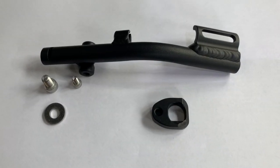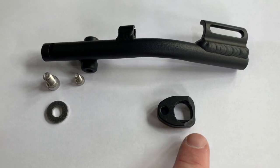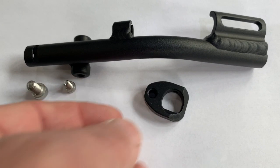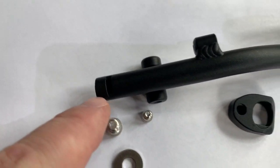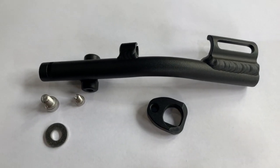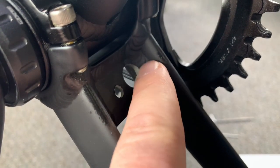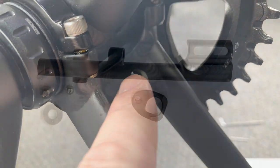Here we have all the parts for the derailleur stock. We have the lower bracket — notice it has a bevel on the end. The bevel is important as it clears the weld. It also has a notch on it that corresponds with the notch on the front of the stock. All of the parts assemble and only go one way. Note the weld here — that's why there is a bevel on the end of the bracket.